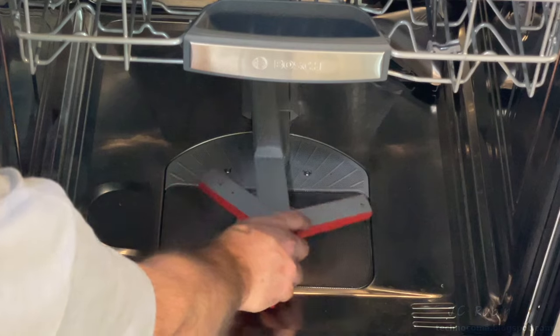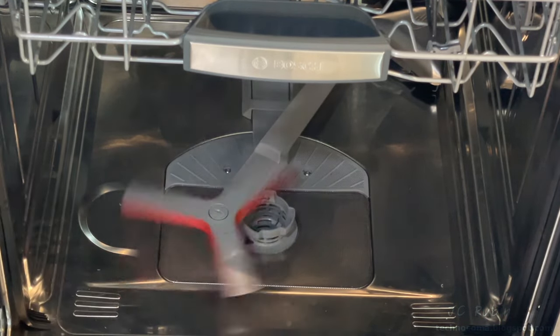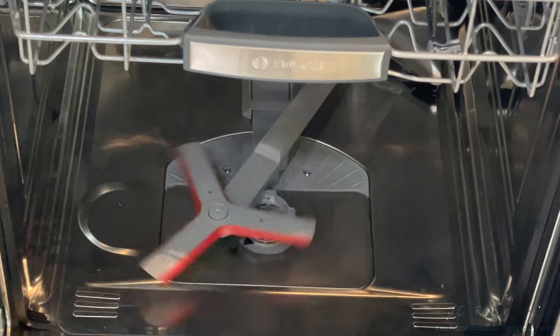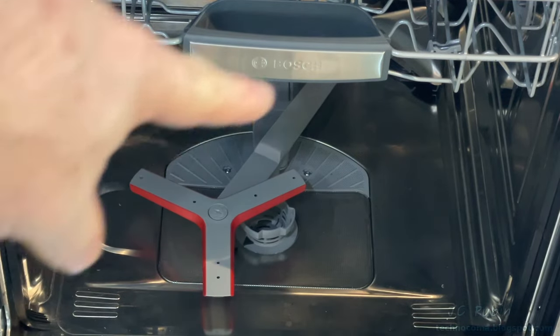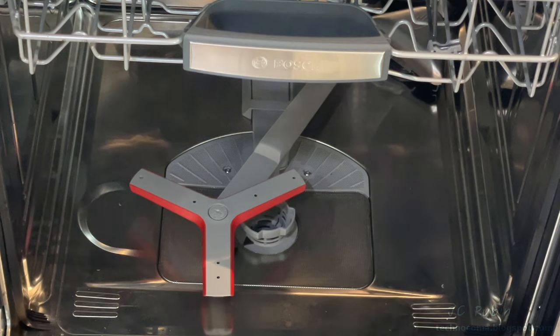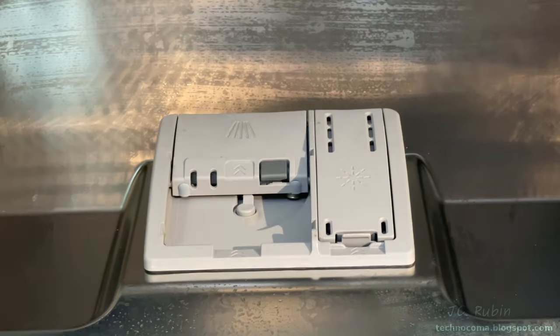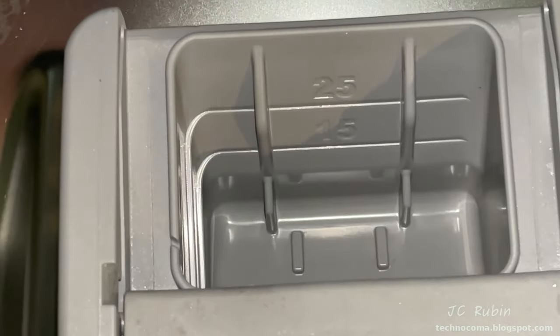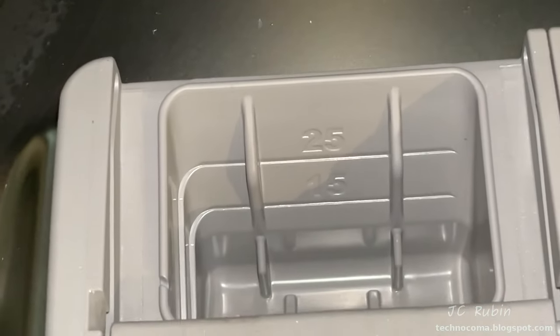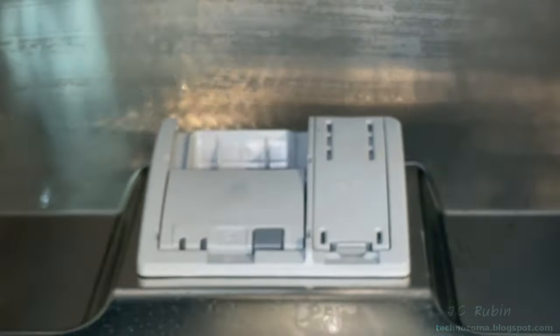Removing the bottom for a better look, this is an actual motor — not powered by water pressure. The spinner off the end does spin from water pressure, so while it sprays water, this motor also spins around in a circle, providing a unique pattern. The soap dispenser is on the door, locked shut after loading. If not using pods, there are measurements written into the plastic for detergent. There's also a port along the side to fill with Jet Dry as needed.